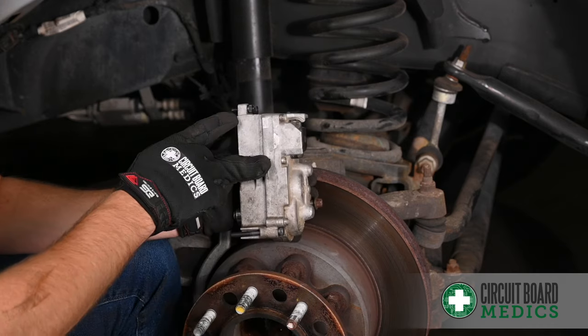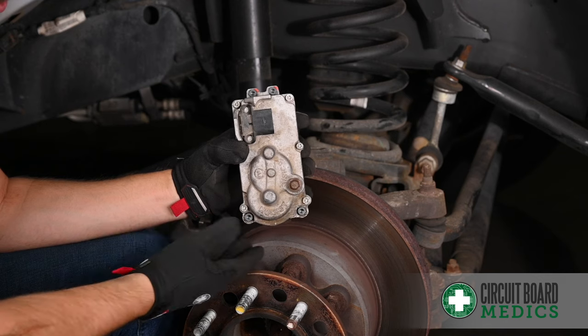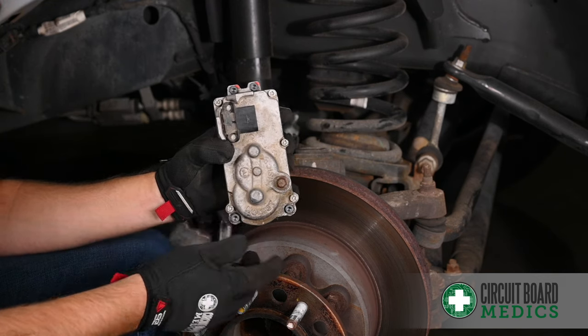The two on the top are shorter, and the bottom left, when you're pulling it out, you'll notice it won't be able to be removed until the actuator is removed because the suspension tower is in the way.